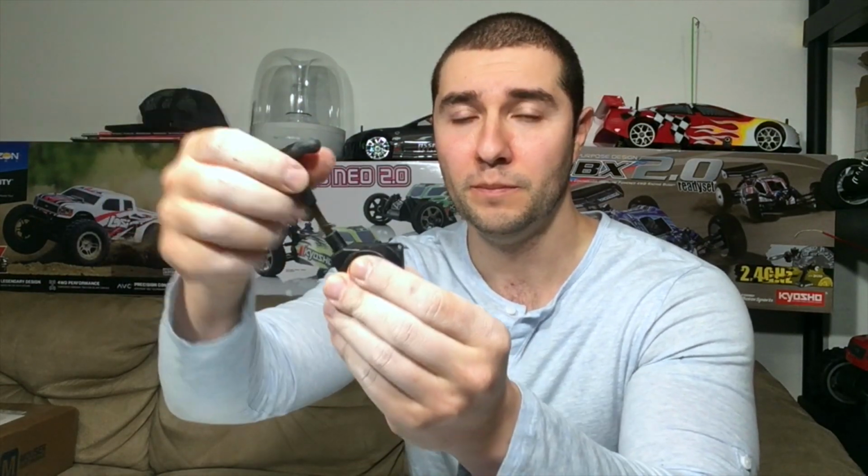I had to use a bunch of solvent, a bunch of WD-40, some compressed air. But yeah, check this out. Retracts, no big deal. Perfect. So WD-40 has a really good property of having the ability to have the sand inside there bind to it. Then you basically just flush it out, use some compressed air, soap, water, boom. Before you know it, your pull start is good.